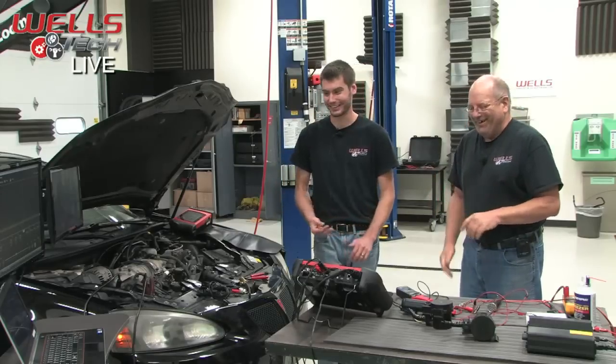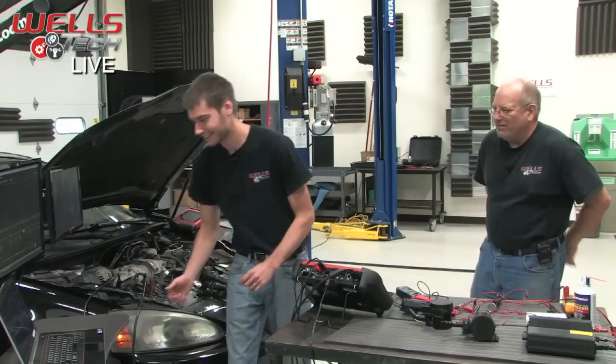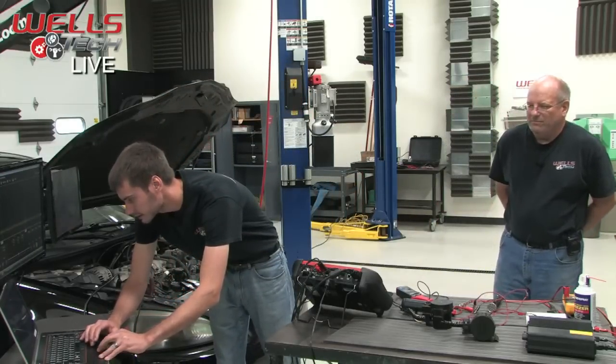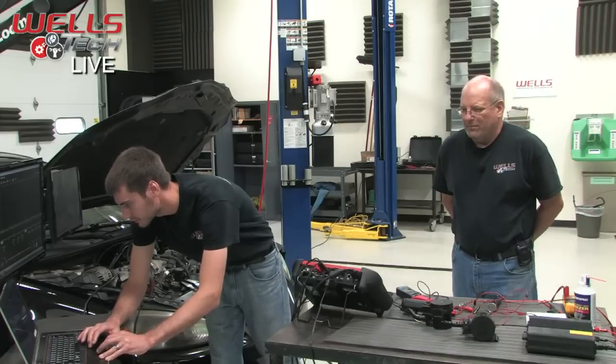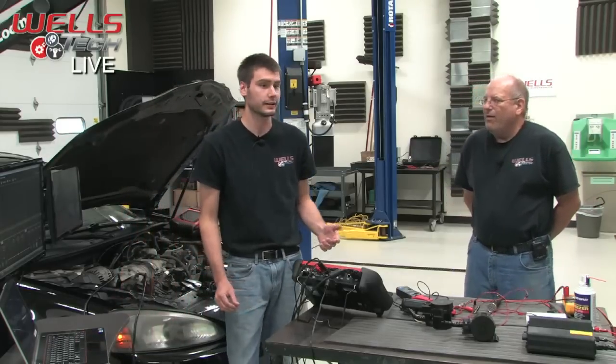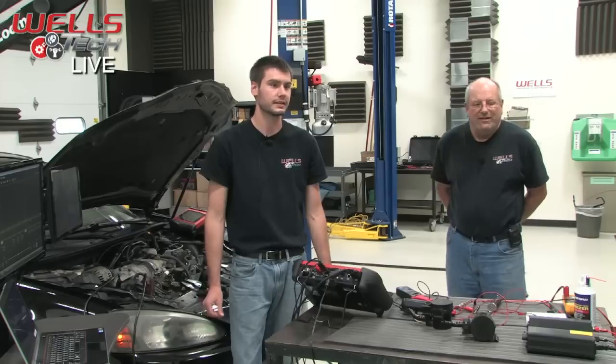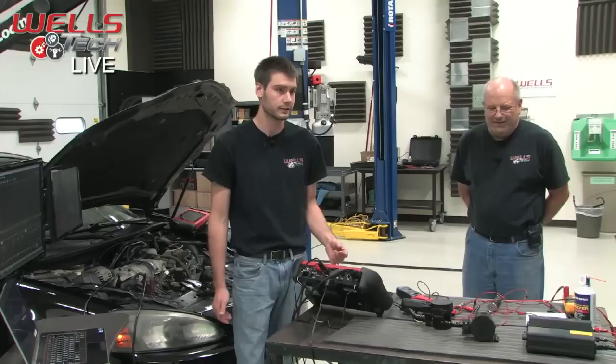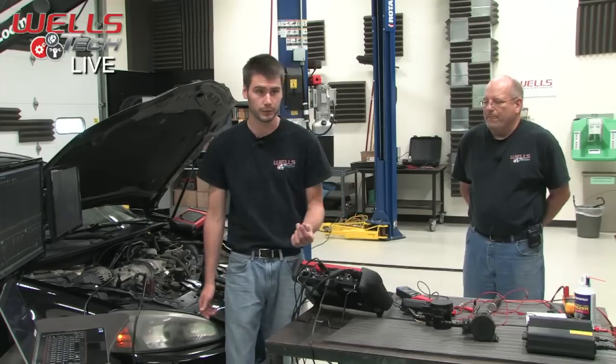All right, let's see what the answers are. Hayward's Automotive says Tech B. I agree, that is the correct answer. Tech B says that the purge solenoid is normally closed. Perfect, and we just talked about that. That's absolutely correct. The vent solenoid is normally open.